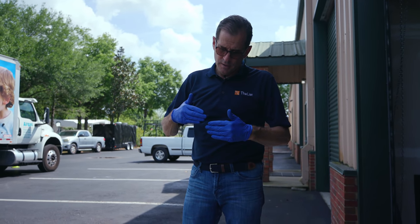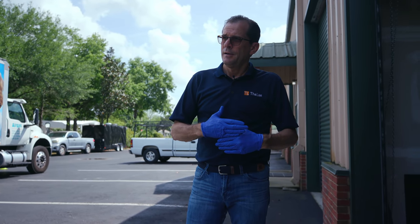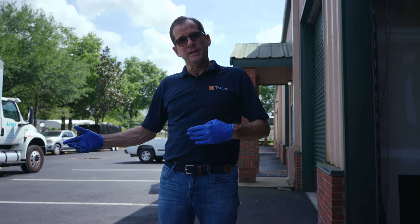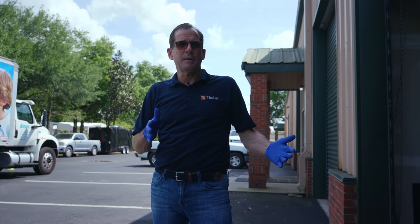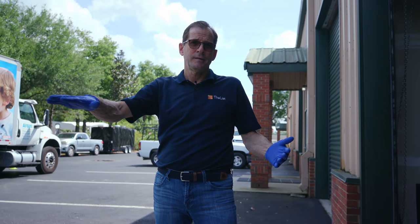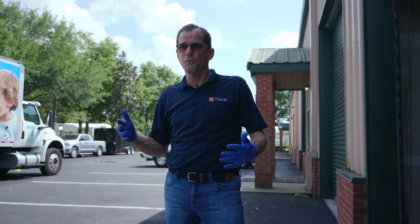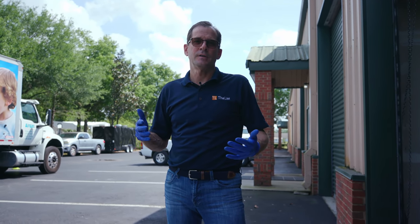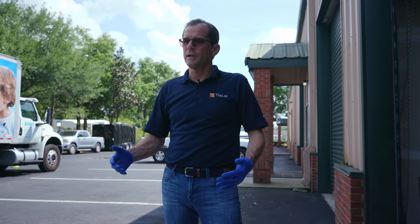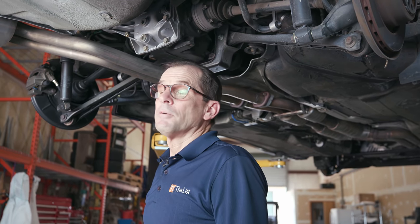If I know I have jobs next week, I'm gonna get my ice around noon on Wednesday, and I want to work the following Tuesday, like we did yesterday, I have to order enough knowing that my ice is going to sublimate. It's going to be half gone in a week. So if I want 400 pounds for next Tuesday, that I want to actually use, I got to order 800 or have 800. And there's no way around it unless you want to spend another 100 grand and make your own dry ice, which I haven't gone to that level yet. Okay, so we're gonna continue to work our manual magic.